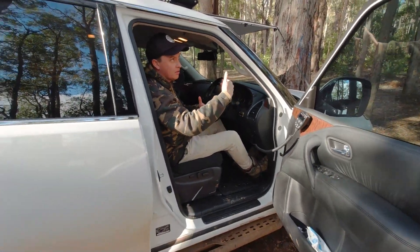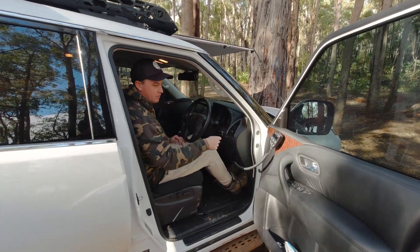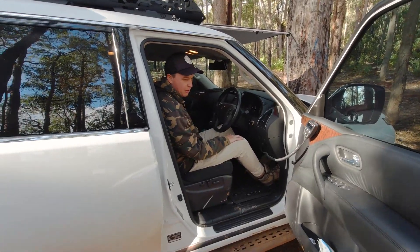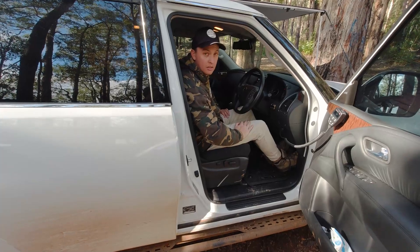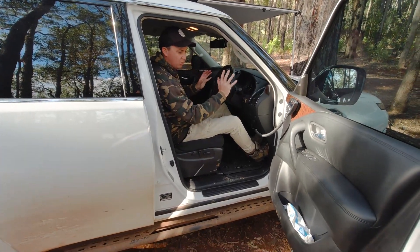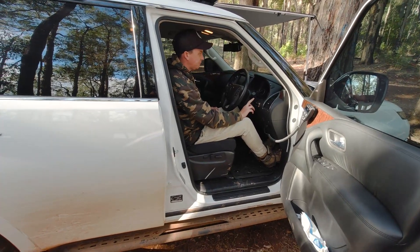I'm going to give David from Dash Off Road a shout out — he sent me this. It's called an S Drive, or Sass, or whatever — it's a throttle controller. It actually makes a big difference for an automatic. You'll probably find when you're taking off these have a bit of a dead spot, just because from factory the throttle is quite lazy. You can trick it from the standard computer — put it in sand mode and it's quite more punchy. But this sort of gives you a bit more punch all round. I don't put it on the max setting because it's always just trying to rev its guts out. The mid sport setting is quite nice to drive on.